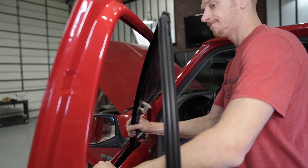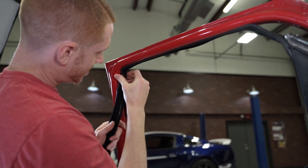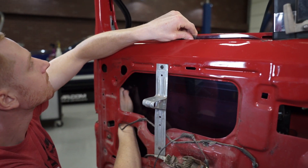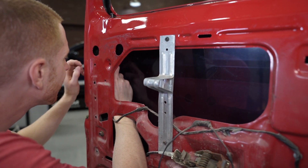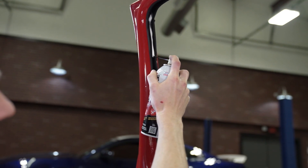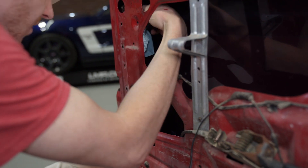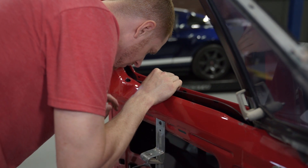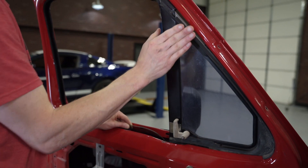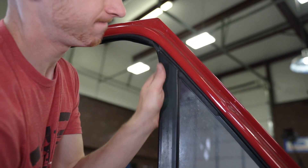Reinstall the assembly into the door. Align the weatherstrip at the top of the door and fully seat it. Bring the door glass toward the front of the door to make room so that you can fully seat the run channel. You may find that a plastic pry tool will help ease the installation. Apply a dry type silicone to the felt — if it helps, apply the silicone to a lint-free cloth and wipe the felt that is inside of the door. Bring the door glass back into the run channel. Align the vent window assembly and make sure the door glass is aligned with the run channel. Make sure you completely seat the run channel at the corner of the door and the vent window assembly.